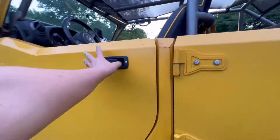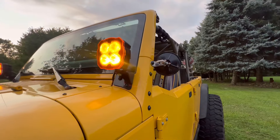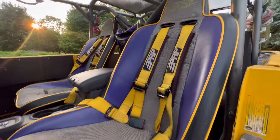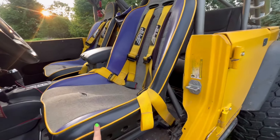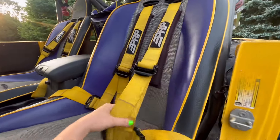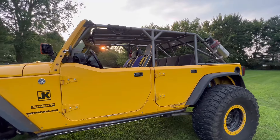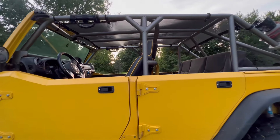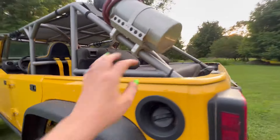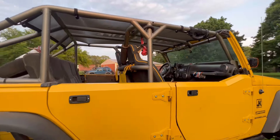I have the Moto-built half doors — I really like them. I have the KC Flexera 4s on my A-pillars. For seats, I am running the PRP daily driver seats. This is not my daily driver, but I do like the daily driver seats because they're not high-bolstering on the sides, so it's easy to get in and out of the Jeep. For harnesses, I have the PRP 4.2 harnesses with the seat belt buckle. For my roll cage, Nick and I hand bent this all up and we use the Undercover Fab cage mounts. It's made with inch-and-three-quarter DOM tubing, 120 wall. There's a better view of my roll cage.